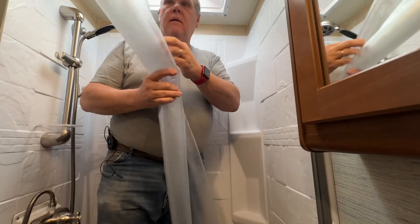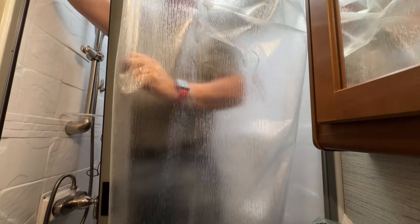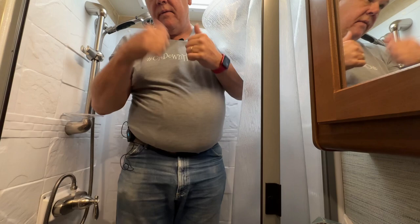You're going to want to pay attention because there is a top and a bottom to this curtain. You can either look at your old one when you took it out, or the instructions will tell you — the bigger seam goes at the bottom. Now what we need to do is go ahead and get this slid down into the tracks.